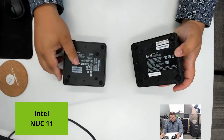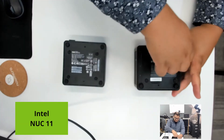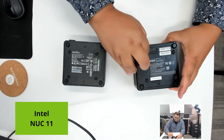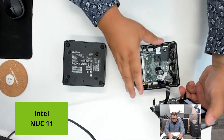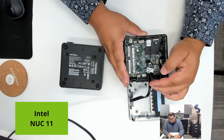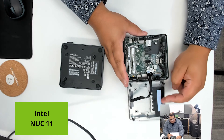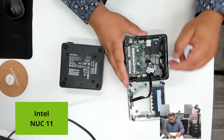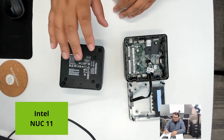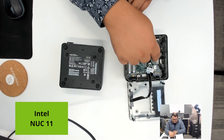Internally, this is another interesting piece. Getting the screws out, we open it very carefully and can see there is a ribbon cable for the 2.5-inch drive support. Here we have the thermal pad for the M.2 SSD that can be placed here. Another notable difference between the commercial unit and the consumer unit is that the Wi-Fi is actually on the board here.